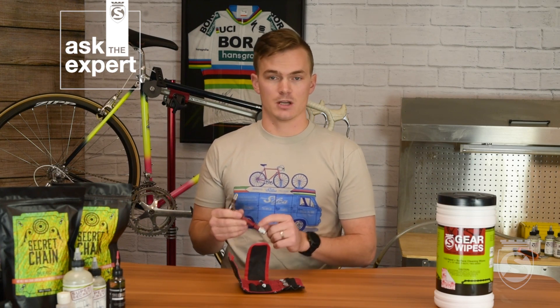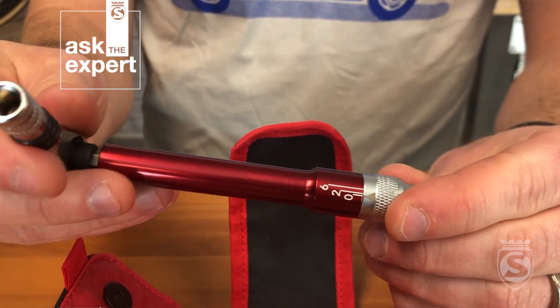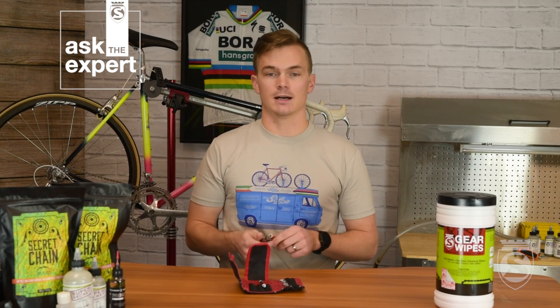The version two torque wrench — one of the big changes we made is the bottom of the barrel is a little bit wider. The original Kickstarter version was the same diameter all the way down and had one scale — zero to eight Newton meters all in one range — which made it a little bit difficult to read. So we made that bottom wider, the text is bigger, the lines are further apart, and we divided it up into three scales: zero to four to eight, zero to two to six, and zero to three and five. Anything up to eight Newton meters you need on your bike — which covers everything except maybe the crank — anything you're adjusting on the go, you'll be covered with this tool.